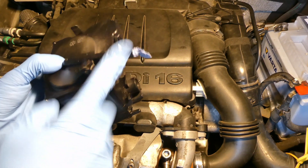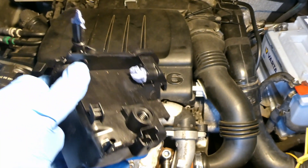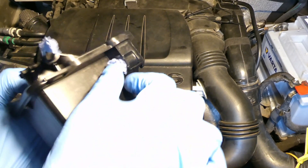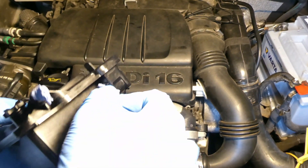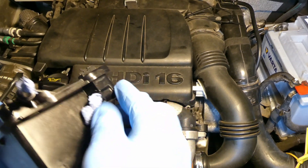The diesel comes in and comes out here. The heater element slots into that hole underneath. These two points hold the diesel element, and it comes inside here. It has two rubber O-rings to stop diesel coming out. I've put a piece of paper there because this filter still has a bit of diesel inside.